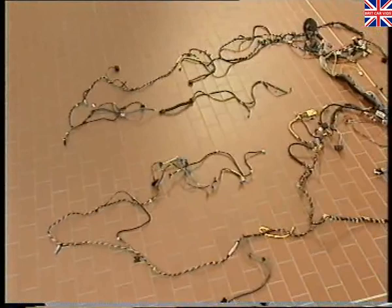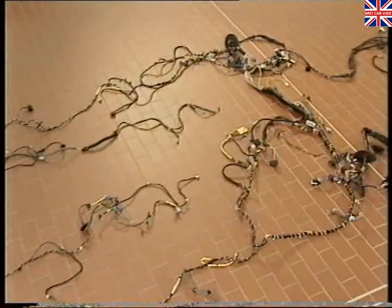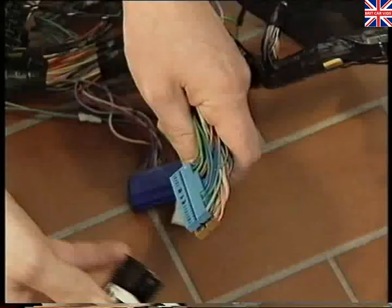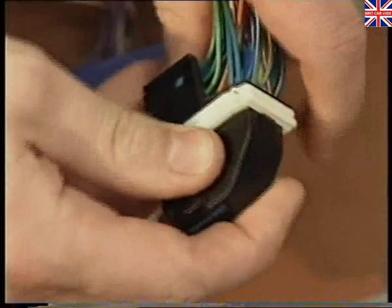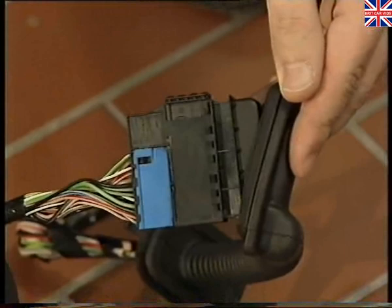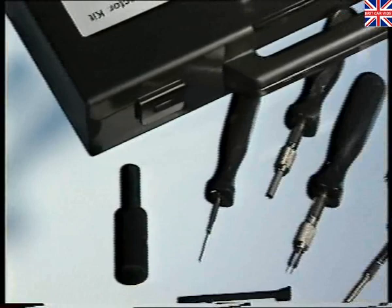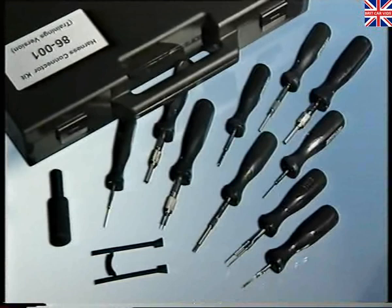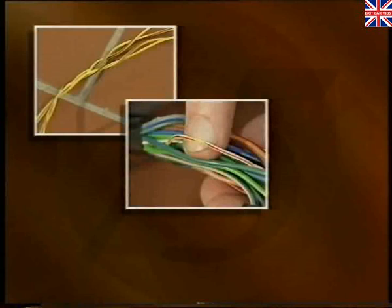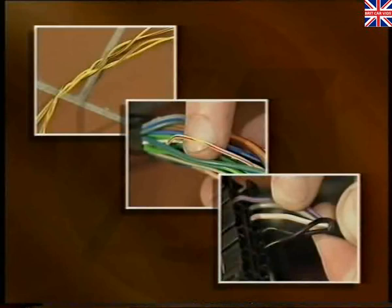The main vehicle wiring harness runs the length of the car from the headlamps to the rear lamps and connects at each door to the individual door harnesses. The sunroof harness, which is also separate, is integral with the roof lining. The harnesses employ many new types of connectors and these require special tools to remove and replace them. The harness can be repaired in sections, which are available from the parts department. These sections are spliced into the existing harness whilst carefully following the repair information. To perform professional and successful repairs, the special tool kit is essential. Incidentally, the CAN bus twisted wires, the single wire K bus, and the single wire diagnostic line are integral to the main wiring harness, as is the SRS harness.